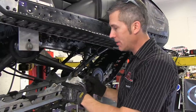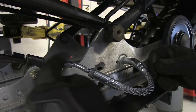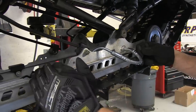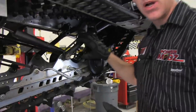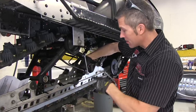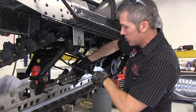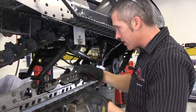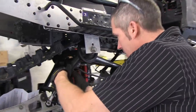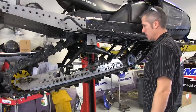One thing you've got to make sure — this doesn't come in contact with any moving parts. The spring guide here, when the spring rolls through it, is still going to miss this. Make sure you don't put it anywhere near where the suspension comes down or any suspension flex parts. You don't want them to come in contact with this because you're going to run into real problems. While I'm here, I'm just going to check all these suspension bolts and torques, make sure they're all tight. This one was loose — these things take a lot of abuse on the trail, so you've got to make sure everything's nice and snug.